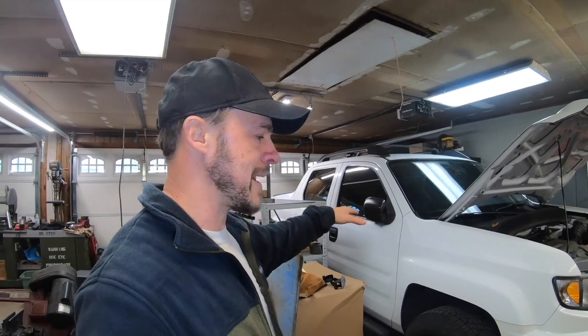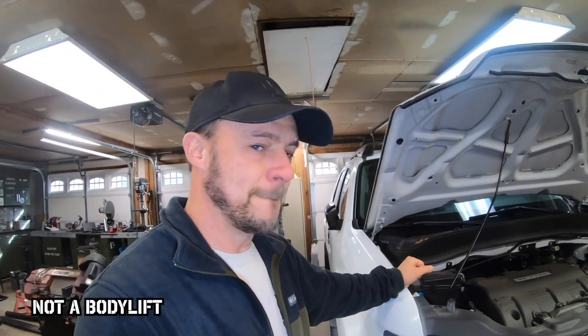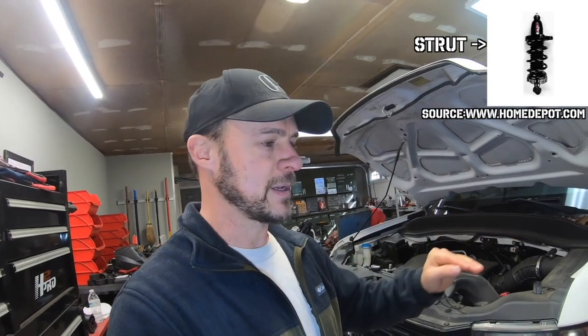I'm going to install the HRG three-inch lift kit, which consists of spacers in the front, spacers in the back, and a full set of subframe spacers that make the three-inch kit work. To be clear, this is not a body lift. A body lift is something you'd use on a truck with a solid frame, and that's not what these vehicles are. This is a unibody vehicle with subframes that attach the suspension components and axles to the body.